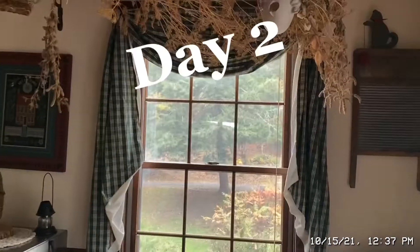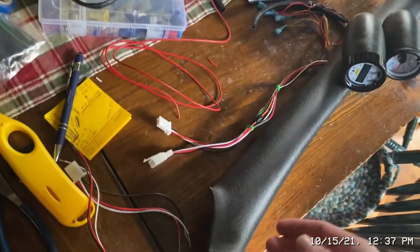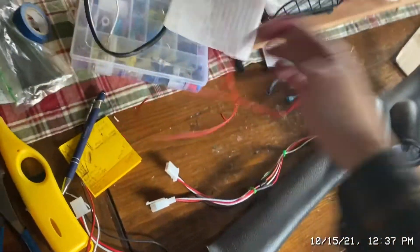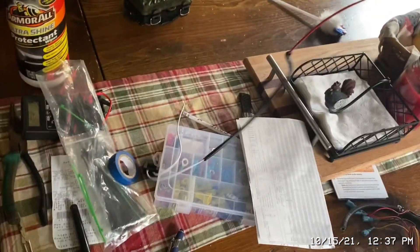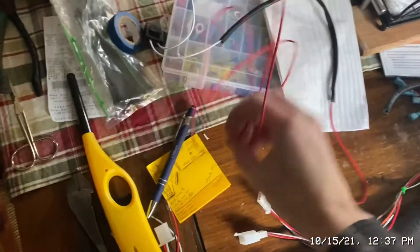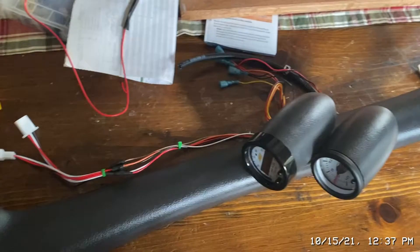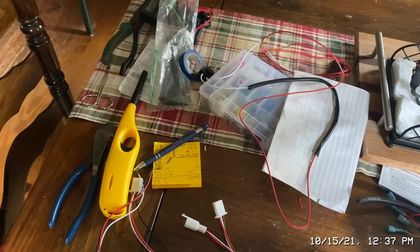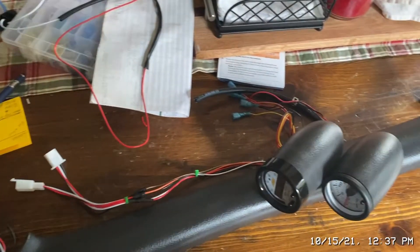It's a new day. I finished all of this last night — the whole thing is set to go, neat and all plug and play. I made a wire with a fuse that's going to be for the constant power to run into the car, because I don't think I have a constant power already. I'm not going to reuse any of the wires already run, like the fuel sender wires, since I'm not using that anymore — but I'll keep it in place just in case.